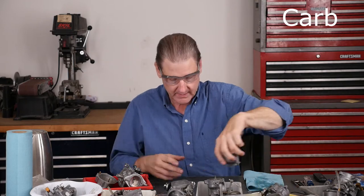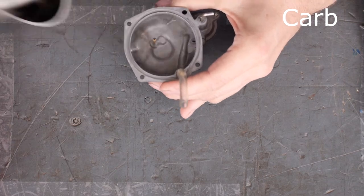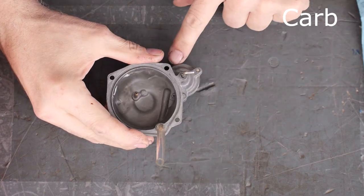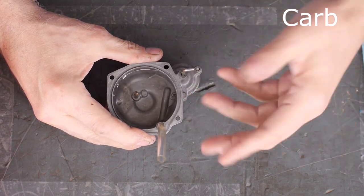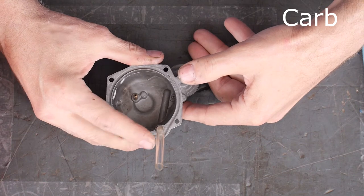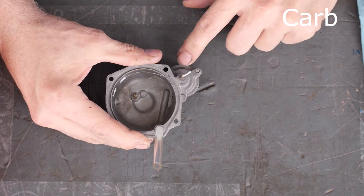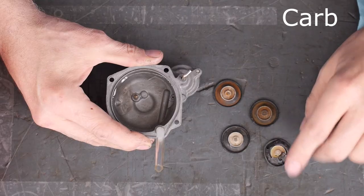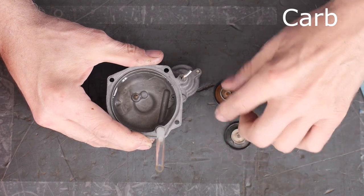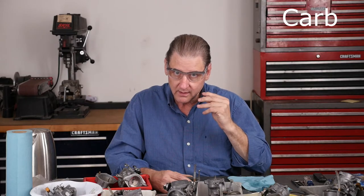I tried all of these. This is a conventional one — all the other ones are conventional. I noticed they're working better. Last night they were squeaking. Some had plugged passages from wax or paraffin from bad gas. Mostly air on the first squirt — a little bit higher, about three quarters of an inch. This is because the diaphragm is so stiff. Here's the bad diaphragm from some old rebuild I've kept — some of these are so stiff. That one actually cracked — that can't be good.